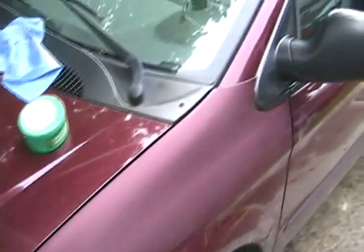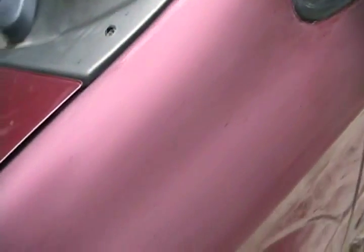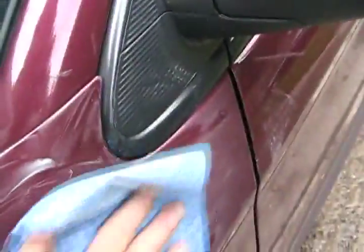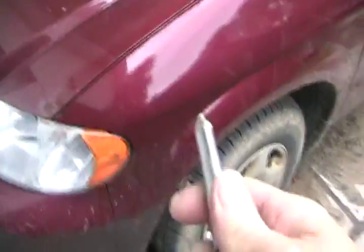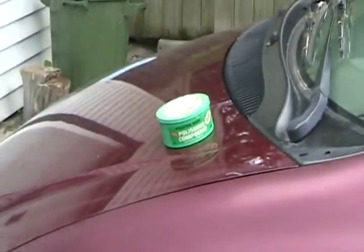As you can see now that the panel is dried, it looks very dull, but that's okay. If I look really closely, I can see I haven't got quite all of those scratches out yet. So that means a bit more sanding — and I still haven't seen the color coming through, so I'm still doing okay. I've still got more room to sand. Now wipe off again with a damp rag. I'll give it a blow dry. As dull as can be, looks like the scratches are out. Now I'm ready for the polishing compound stage.